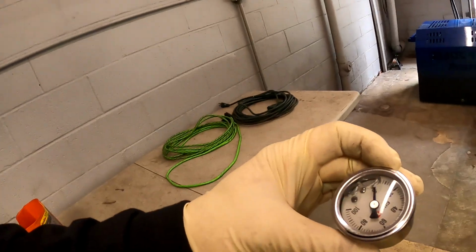Considering the way that it's doing it, I think the likelihood of there being a fuel pump problem is probably pretty high. So I'm going to see if there's a port or something where I can hook up a fuel pressure sensor, and we'll log that, because there's no reason to jack the fuel curve all up trying to chase a fuel pressure problem. So let's see if that's what's going on.